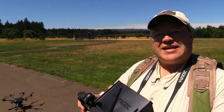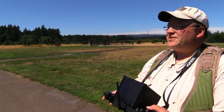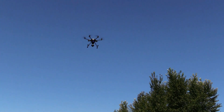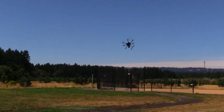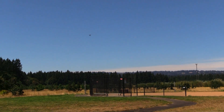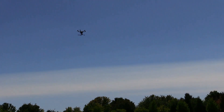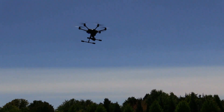Like other Typhoon aircraft, you can disable the GPS — just click calibrate GPS and click off. Flying in manual mode with no GPS, it's still auto-leveling but it's kind of old school. It floats with the wind and you have to stop it from going forward because if you let go of the sticks it just keeps gliding in the direction you were going. You have a lot more speed with GPS off — there's nothing limiting how fast it'll go. Also, you may need to add a bit of throttle as it descends when accelerating beyond its normal threshold. Not for beginners — do not play with this mode unless you're prepared to lose your aircraft or you have a practice course. It's definitely a different animal without the GPS on.